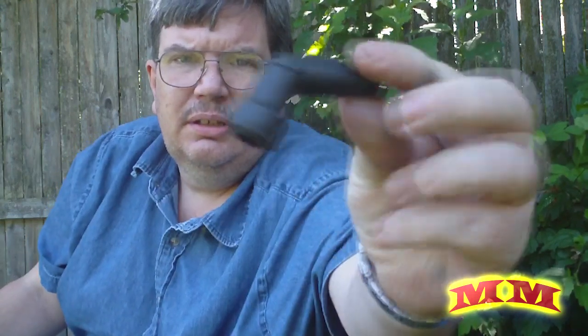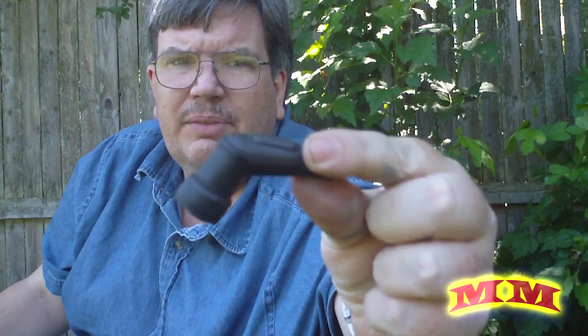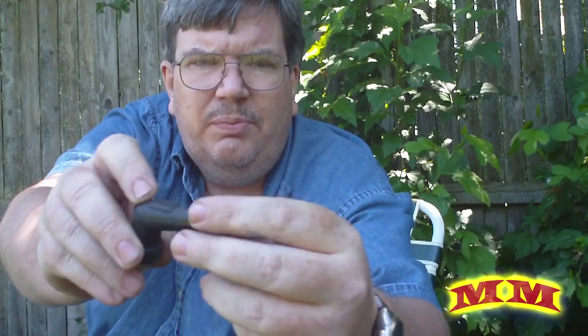This is the cap I'm talking about. The resistor cap. The resistor is actually inside of where the wire goes in, on this side. Normally, you can take a screwdriver in there and turn out the center, and there's a little resistor in there. These are just throwaways. You can't do that. And since it's missing that much, from here to here, the wire is going to be too short, because all I did is put a rubber boot on with a little clip to go over the spark plug. It's missing that now, so it's too short. Somebody's cut these wires down in the past.